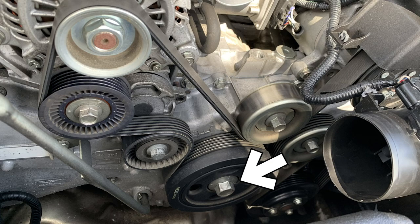And for the crank pulley, what you need is a breaker bar, preferably a really long handled one, but since that's kind of hard to get, just get a regular breaker bar, go to Home Depot, pick up a lead pipe that's really long, one that'll fit onto the handle of the breaker bar. And now you've got a really super long breaker bar. It's got some weight on it, so you can use it to break that bolt. And once you've broken the bolt, you can actually unscrew it with your hand and just take the bolt out.